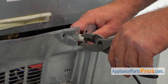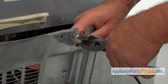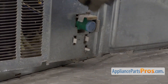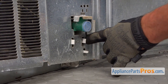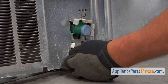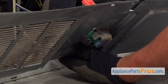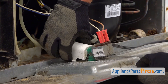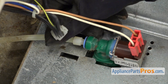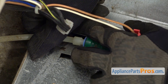Next, I'm going to use the pliers here and I'm going to turn this plug and remove it. So now we can remove this cover and flip it up, and then there are tabs that need to be pressed in. Next, I'm going to pull out this water line from the valve and press down on that blue collar to release the tube.